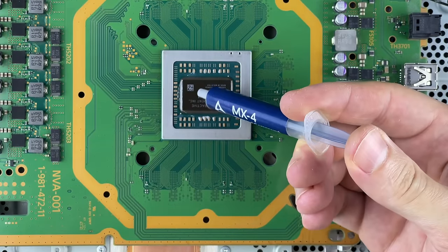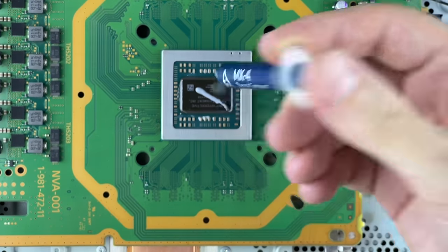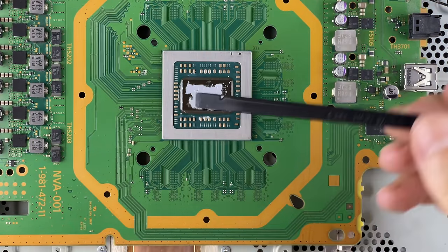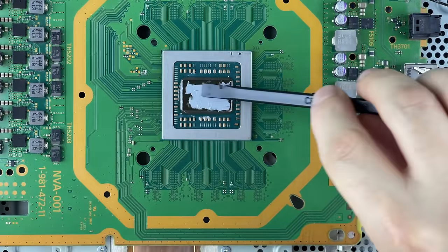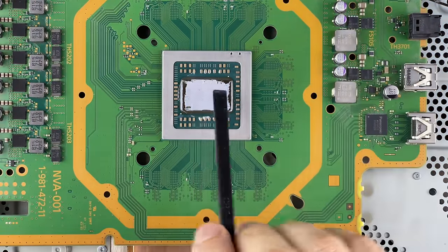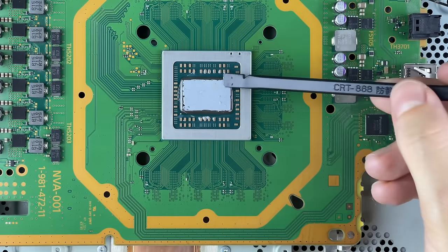Apply a small amount of thermal paste to the APU chip. Then, using a plastic tool, spread it evenly over the entire surface of the chip. I tested different thermal greases to find the best one for PS4 Pro. If you don't know which thermal paste to choose for your game console, check out the links in the description.